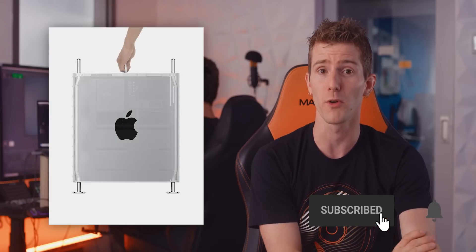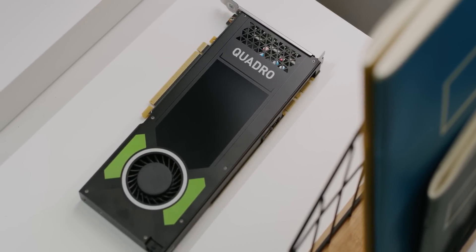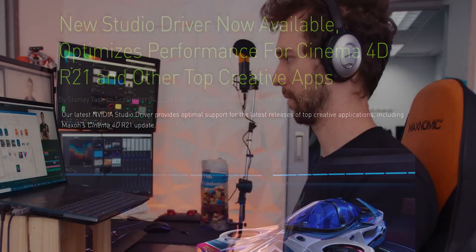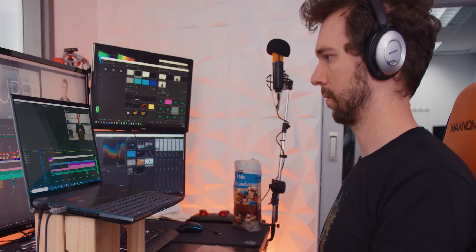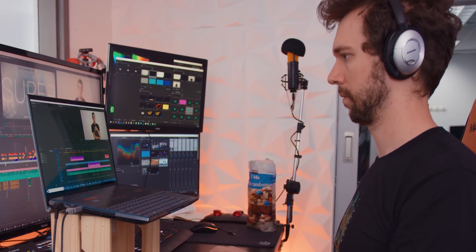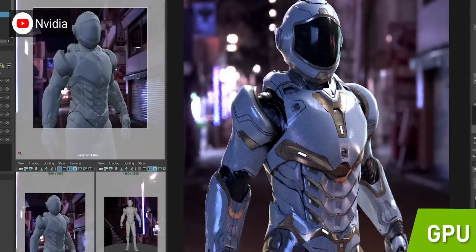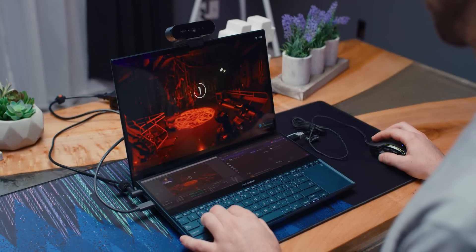By the way, we'll be putting Apple's upcoming Mac Pro through the paces once it's available on the subject of thermal throttling, so get subscribed so you don't miss that. And the performance story here is great on the graphics side of things as well. While it's not going to be on par with a top-of-the-line Quadro GPU in certain professional applications, the RTX 2060 with NVIDIA's pro-optimized studio driver ends up being a great middle-ground option. It can be used to power real-time video effects like accelerating high-resolution RED footage playback, or applying denoising effects in DaVinci Resolve. It can accelerate ray-traced scene creation, as we saw during NVIDIA's demo day where they showed off RTX support in the Arnold renderer. It can encode high-quality video in real-time using NVENC. And of course, it can game, which presents a spectacularly interesting use case for the Pro Duo.